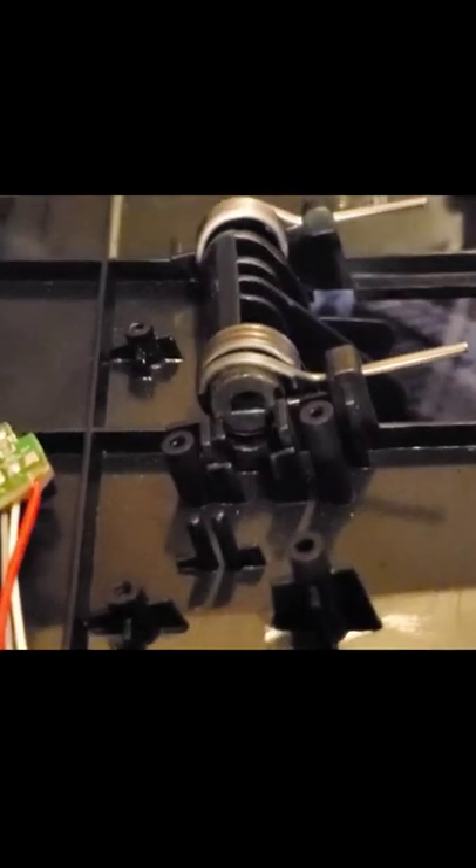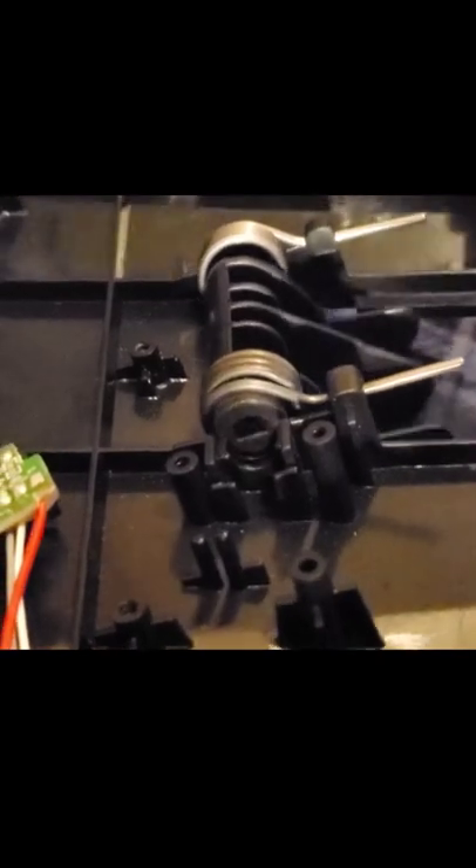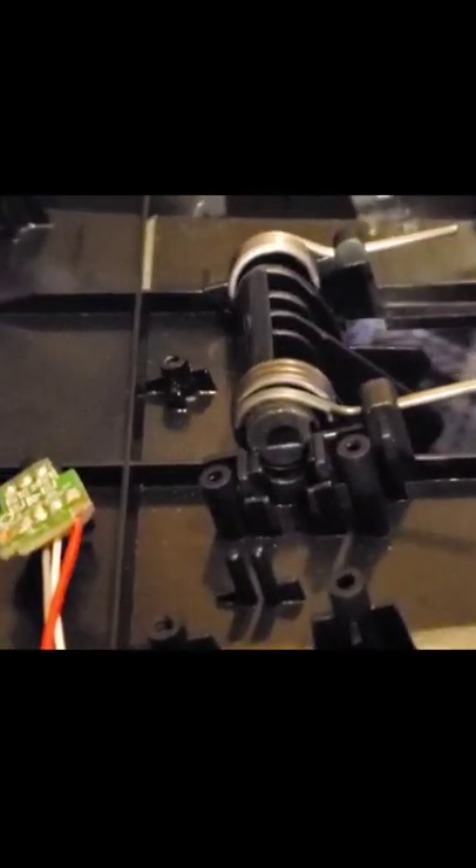You can see at the end it lifts right up. If I put enough effort in I could make it so that it didn't lift up like that, either by weakening the other spring so it's not pushing up as hard, or by tightening this one a little. What I'm going to actually do is probably drop some glue right in the little slot where the potentiometer sits.